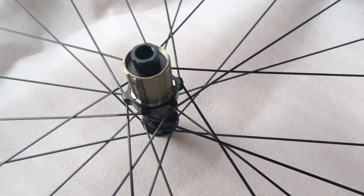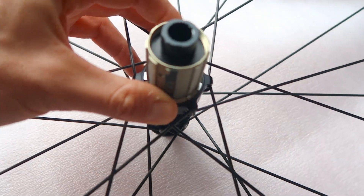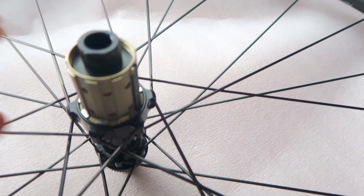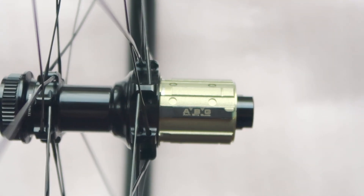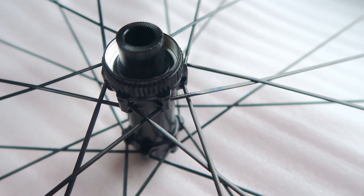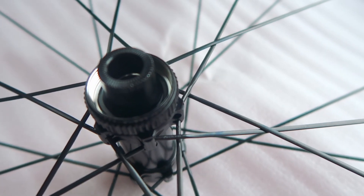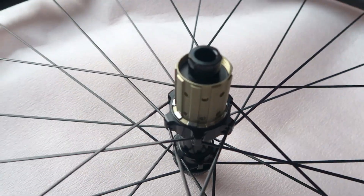You don't really know which is taking the load first, and if that steel part is bearing the load first, then it's taking all the torque from the cassette and the other parts may not even be touching. This part is actually epoxied on - I've seen that on other hubs before. How long that's going to last if it's taking all the load, I'm not sure. I've never really thought these anti-bite guard things are necessary. If your freehub body is made out of 7075, which is double the hardness of 6061, and if you torque your cassette up to 40 Newton meters, I just don't think these anti-bite guard things are necessary.